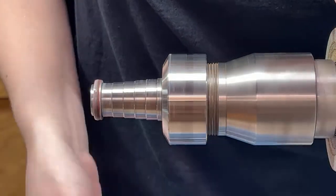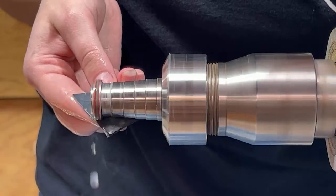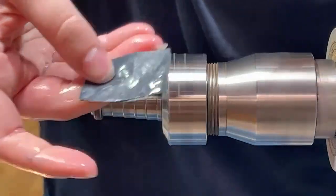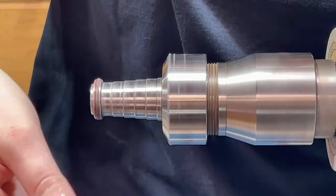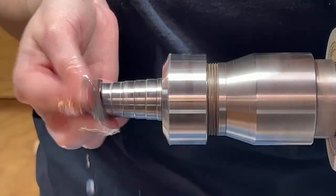That white, wet material is kind of what you're looking for. There's a sweet spot between getting that white creamy material on the thing — that's what's turning off, that's how you know it's going down — and then burning. There'll be like a brownish spot on there if you've burnt the sandpaper.